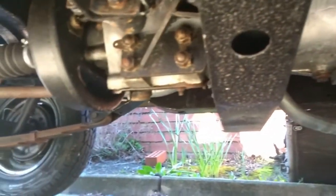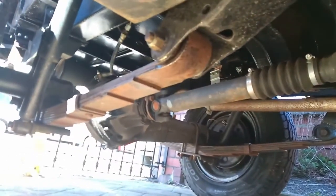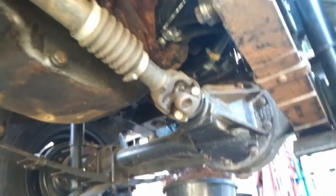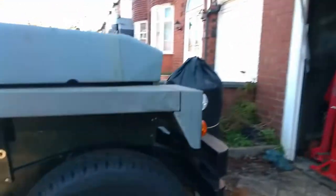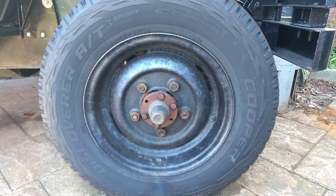The chassis is galvanized, painted with etch primer and a thick coating of chassis paint. The front axle has been completely rebuilt with new gaskets and seals. There are a few minor spots of rust on the prop shafts, however all of the bearings have been replaced and fitted with gaiters. When I rebuilt the wheel hub I was missing two bolts, but these can easily be replaced.